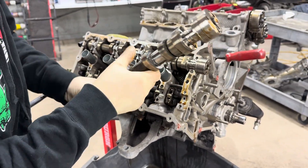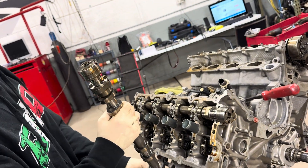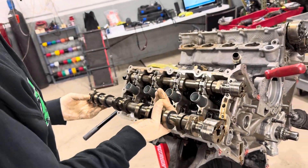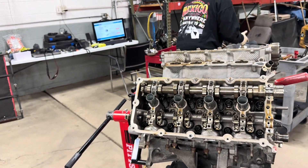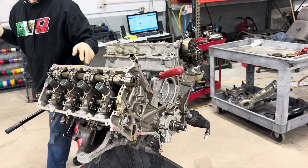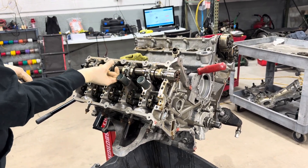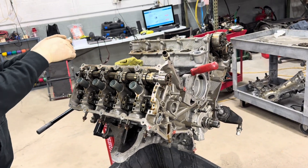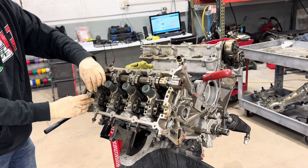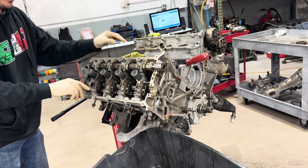That's a short cam. I'm used to those long ones. And they're hollow. You didn't want that. At least that was really high spring load — well, maybe it doesn't matter in this case either. For real race engines, the bearing diameter or the core of the cam is really large, because the spring pressure is so crazy it'll bend that thing — it'd knock the lobes off one of these on first startup.